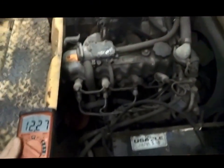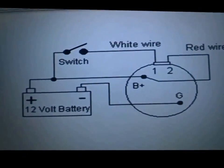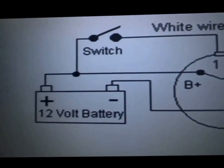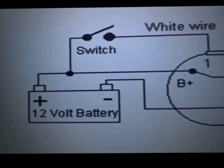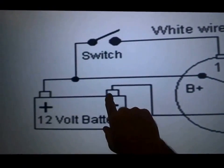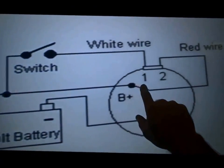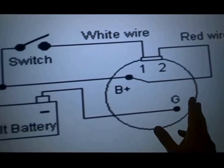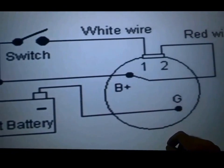The charging system voltage right now was about the same as battery voltage, so the charging system is not working. We're going to walk over to the board — this is the basic wiring diagram. We've checked it here at the battery and we're getting about 12.2 volts. I charged the battery beforehand to about 12.5 to get it running. We're going to check the ground circuit and the positive circuit coming into the field exciting circuit, and diagnose whether it's a wiring problem or an alternator problem.